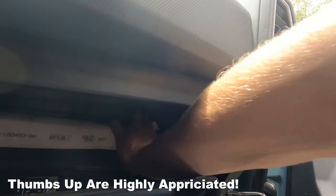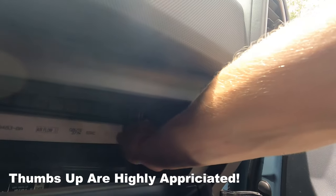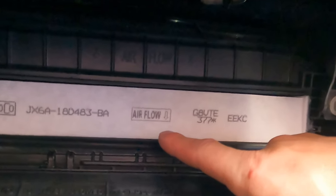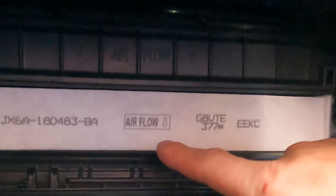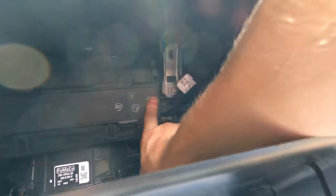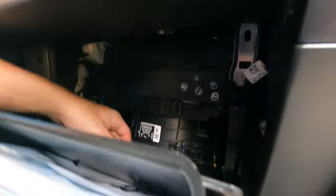It's a little hard to do with one hand, but here I am going ahead and attempting this. Once it is flush up against the back of the air filter compartment, just make sure that the airflow matches — it's supposed to go down. Then pop back on this little cover and pop back up the glove compartment, making sure that everything's all tidied up. Push the glove compartment back and it pops back into place.